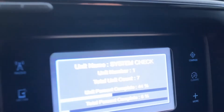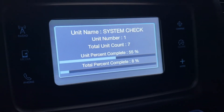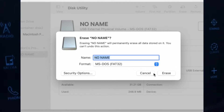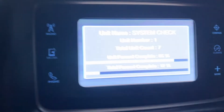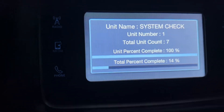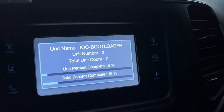This is my second attempt — it's a little darker now, but long story short, I ended up formatting the USB drive. It's a 32 gigabyte USB drive, formatted on the Mac to MS-DOS FAT32 — I'll put it on the screen to confirm. I just turned the car on and plugged it in, wasn't even trying to update it, and it seems to be working. I literally just plugged the USB in right after I turned the car on and it just started doing it on its own.